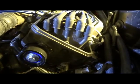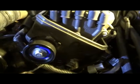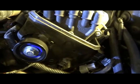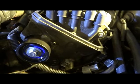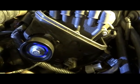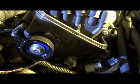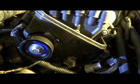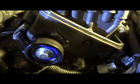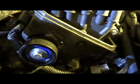Okay, one of the more difficult things is to get your hole, which your pulley is going to get clearance through, sorted out. I just measured it all with the pulley on there, but the easiest way is if you can work out approximately where the center is, and as long as you've got a big enough hole to clear the boss on the back of the pulley, you can then wind it in, mark around the pulley and cut it, so that's pretty much the size. As you can see, mine's a little bit oversized because I did it the hard way. But yeah, put the pulley in after, so the cover goes on first and the pulley goes on after.